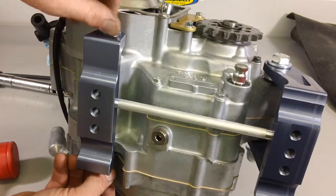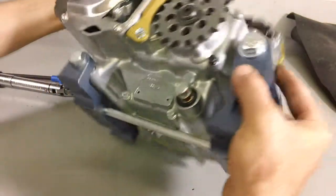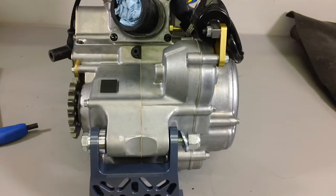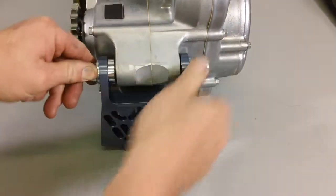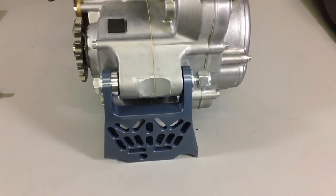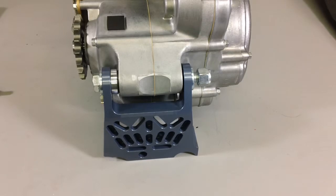In this video we're installing the engine mount to the engine, leaving all hardware loose except for the rear 6mm Allen bolt — that one is tight. The engine mount hardware for the cases and the front tie rod bolt are all going to be loose. Tune in to our next video on mounting the engine mount with the engine to the chassis.